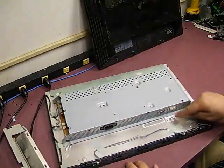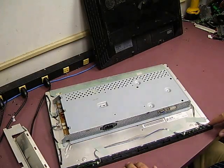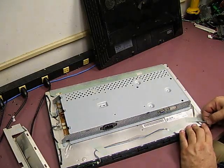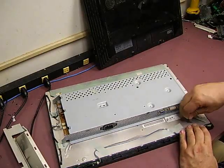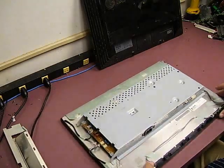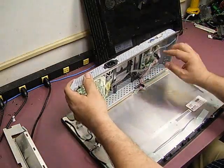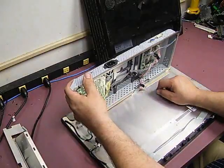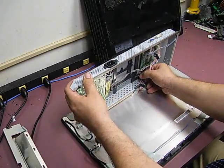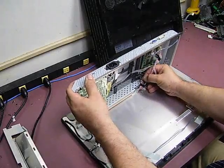On the opposite end, you have a blue and gray cable that comes out and goes to the front control panel — this is the power switch and indicator cable. You need to disconnect it, unplug it from the front control panel, and pull it out from underneath the tape. You can put the tape back to hold the cable when we're finished. Now we're ready to lift the assembly up slightly, and you will see the cable that goes from the video control board to the LCD panel. That cable goes through a little cable management channel, so work those cables through to free up a little extra play.